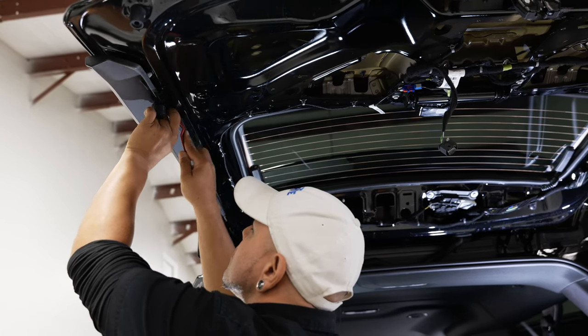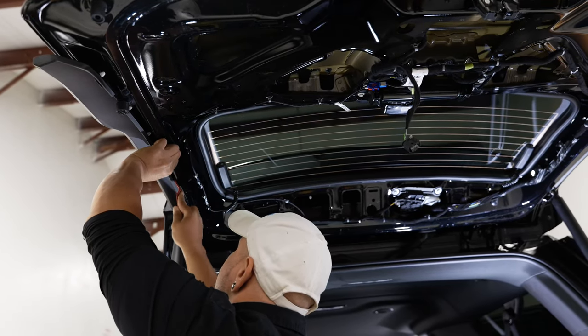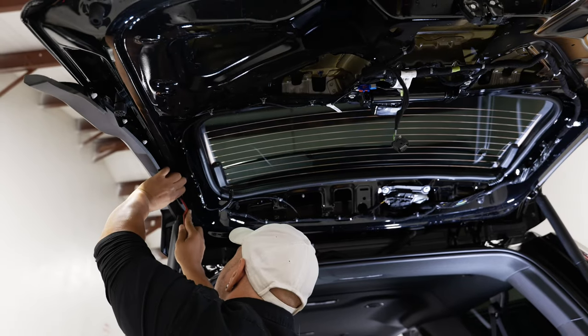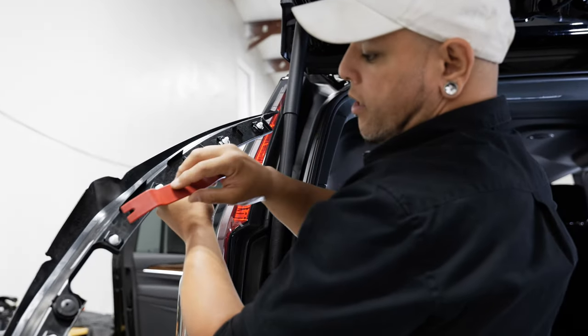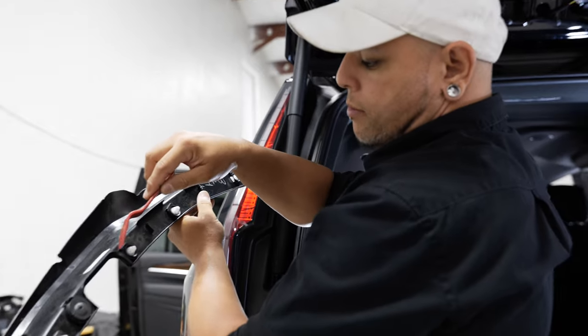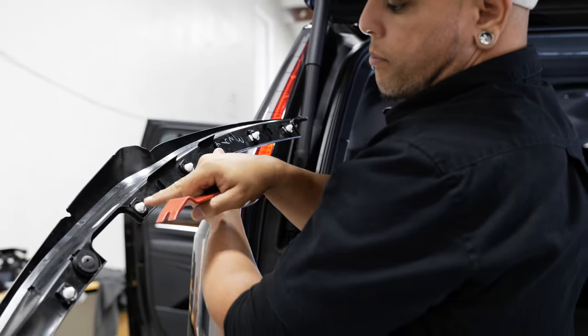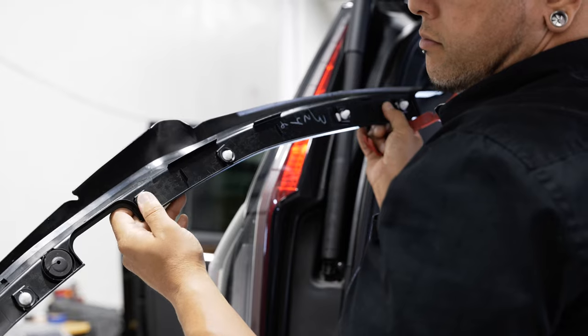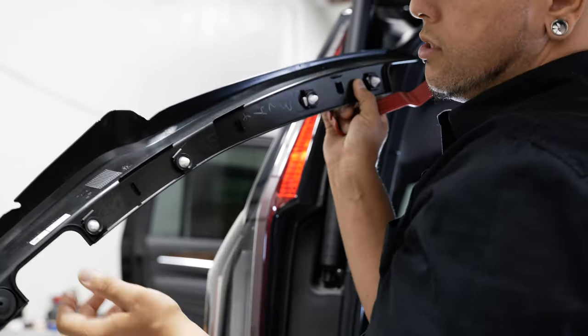There's one right here and one more up here. On this panel, same thing I warned you about — what usually snaps off is either the base of the clip holder or the clip itself will be so brittle it just shatters. If you have some sun damage or sun age on your vehicle, maybe get some new ones. This Cadillac is completely brand new so these are all fresh and we don't have a problem with anything breaking. We're going to do the same thing on the other side.